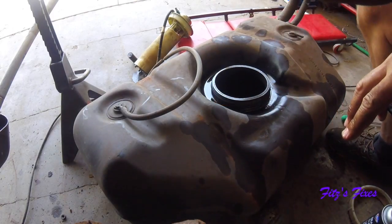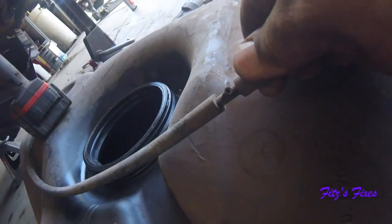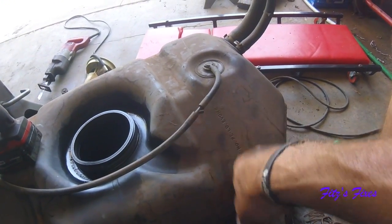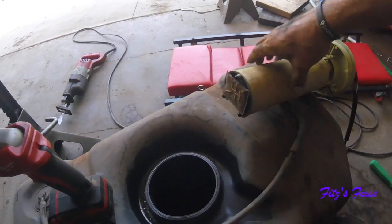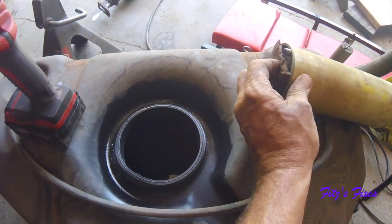On further inspection, I can see that this hose hooked into here - it's just a little extension piece to get it over to the tank. But this hose right here is zip-tied to it, dangling, with a small hole in it. There's a little hunk of plastic in there that matches up with a piece that broke off. So this is where my EVAP leak is coming from, because this is supposed to go up to that canister under the hood - the black canister. You saw me pull the pump off, and this little filter was sitting in the bottom of the tank.